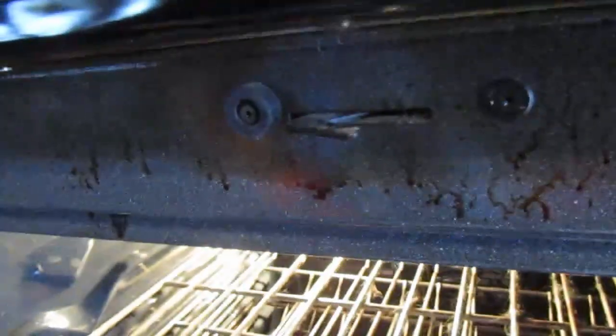Well, I fixed the squeak. It no longer squeaks. All I had to do was this, whatever this thing is. I don't know if you can lock your oven for whatever reason there might be. But whatever, all I had to do was bend this tip down just a bit, because you can see the paint on it's worn. So I just bent it down just a slight bit. Now it rattles when you jump, but it doesn't squeak no more.